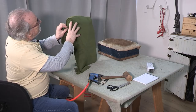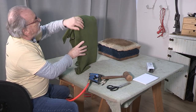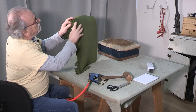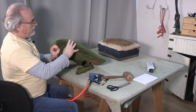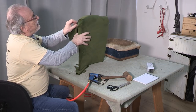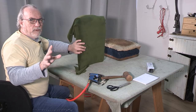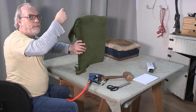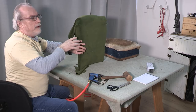You see that? See how our cover, you have to remember, pleats always should be running down. Try not to do this. We do this on fronts of seats, but not on a back. You want to make sure both pleats are running down. That's for wearability reasons. If you run a pleat the opposite way, it wears out much quicker, even if it's a mohair.